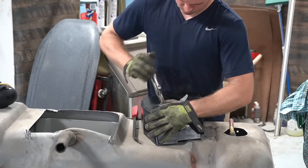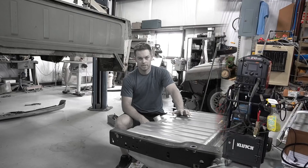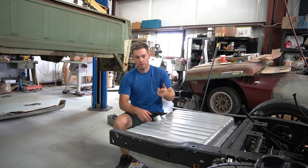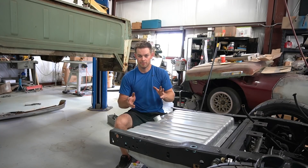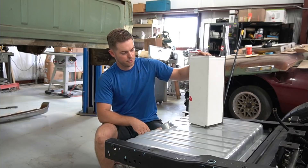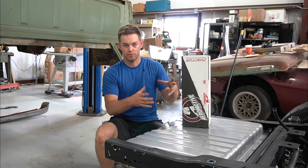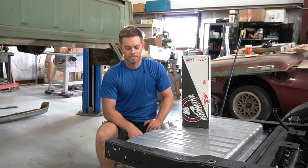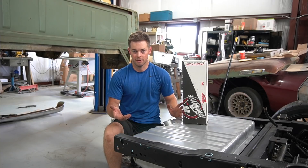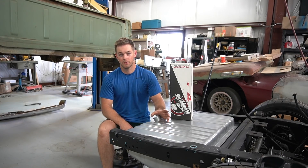So that's the quick fast-forward version of how this video was originally planned to turn out. Now back to the Aeromotive install and what I actually did to feed fuel up to the motor. My two biggest concerns were: one, having enough fuel volume to feed that motor - I'm doing a turbo LS1, so I'm figuring somewhere around a 400 lph pump is what I need. I made the decision to go with the Aeromotive universal stealth system, the in-tank system with the bladder around it that keeps fuel around the fuel pump at all times for hard corners. I was super concerned about having fuel starvation issues.